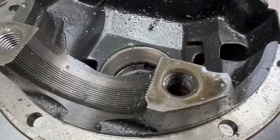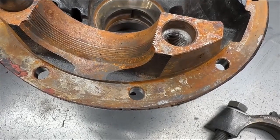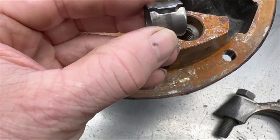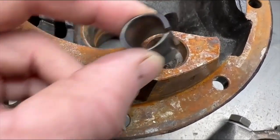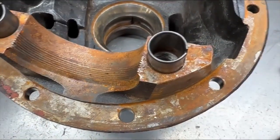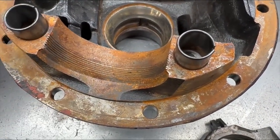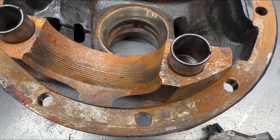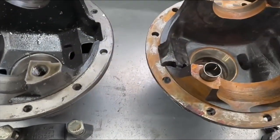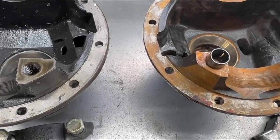Here you have the casing of a standard early short nose, and here you have the casing of a later short nose. What they did was fit these collets into there — that collet gets quite solid, and when you bang that down, the carrier cap is much more solid and it stops the shuffling. But it doesn't stop the silly pin. So even on the casings there are two different types, and we'll move on to tell you what else is wrong with these units.